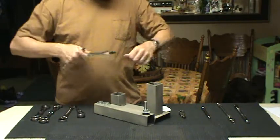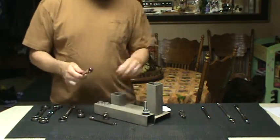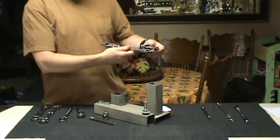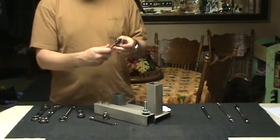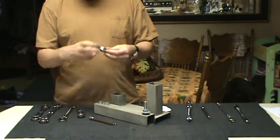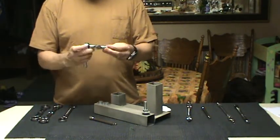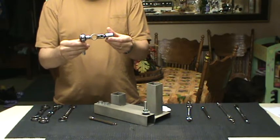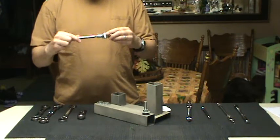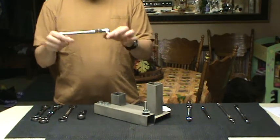Now I have a short version of this very wrench that fits in your pocket. This very short one does the exact same thing as this long one does. All you have to do is put your socket directly onto it. You use your ratchet. There it is, an extension. It's a 3-inch straight through extension. When I use an extension on it, now I have a breaker bar.